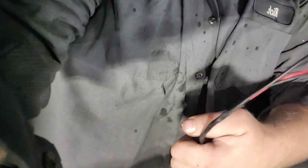Where my connection problem was, was right here on the side under the driver's seat at this connection. It was poor. I tried to fix it, but you can't appropriately fix these if you don't have the tools to re-crimp the ends. I attempted to fix it to get the customer by until VOXX sent me the new harness — it didn't work. I don't have the right crimping tools or the knowledge to remake the ends on these things correctly.